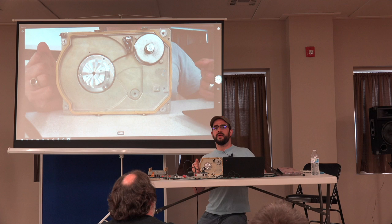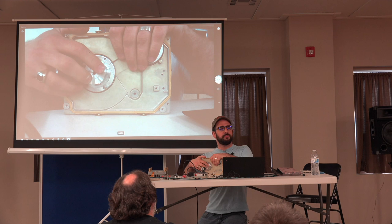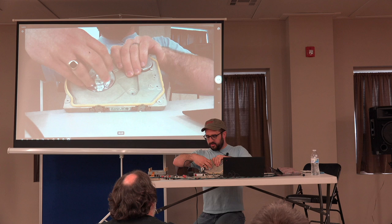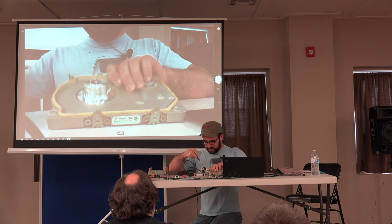And then there'll be a pop where the driver circuit for this motor explodes, because the motor has so much drag in it that it overloads the motor driver and pops the chip. So this one isn't as bad as some that I've seen, but it's not great.